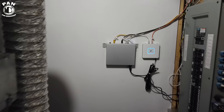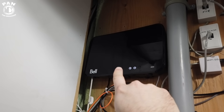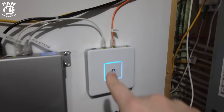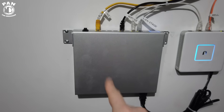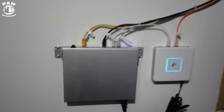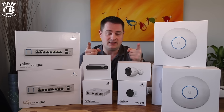We move on into the electrical room where I have the rest of the equipment installed. First of all, this is my modem from my internet service provider — a gigabit per second fiber optic connection. This feeds into the UniFi Security Gateway, which is the router. From there it feeds into the first switch — an eight port switch. Into the UniFi Switch 8, we feed the CloudKey Gen 2 through ethernet. From this switch, it goes all the way up to the floor where you saw the first switch. Pretty simple, very neatly installed. The performance is absolutely insane, as you'll see by these next clips.